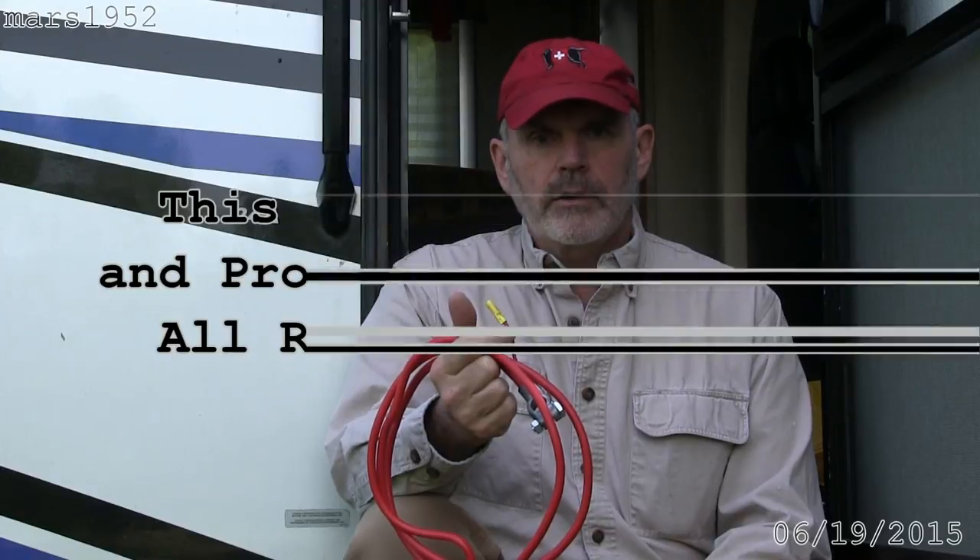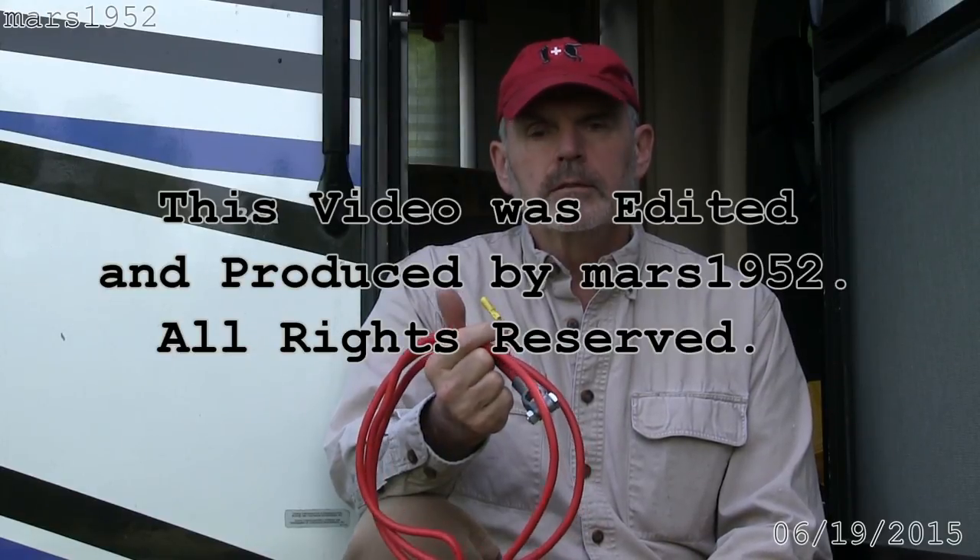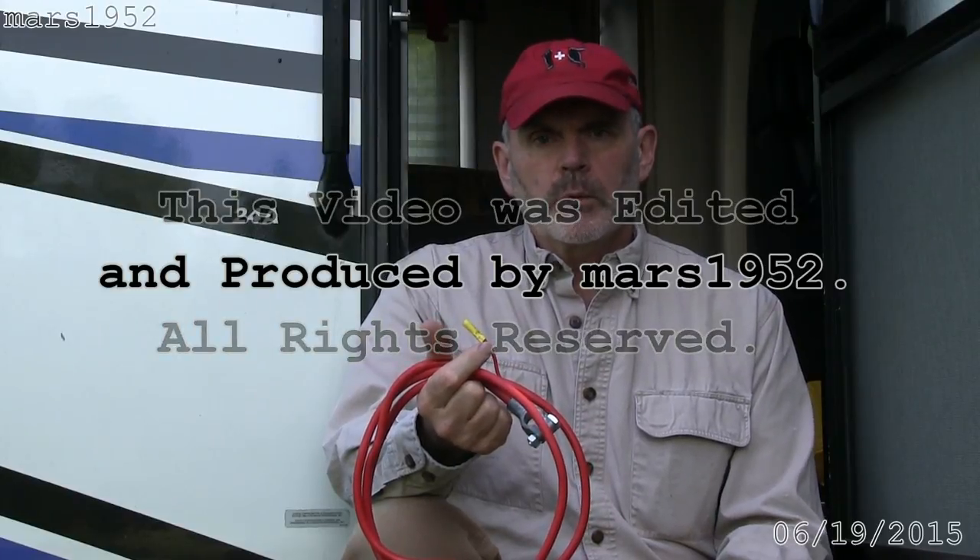While you're still here, I'll explain how I figured out that the fusible link was bad. I bought the RV in the winter, brought it home, charged up the batteries — everything seemed okay. The previous owners had parked it in a storage lot and let the batteries run down. They'd shown it to a number of people, jump-started the RV, and actually charged the coach batteries with a car. That probably burnt out that fusible link. I got it home, charged it up, cleaned it up, changed the tires and a bunch of other stuff, and we headed out on a trip — and the mistake was we went on a long trip; should have gone on a short trip to figure things out.